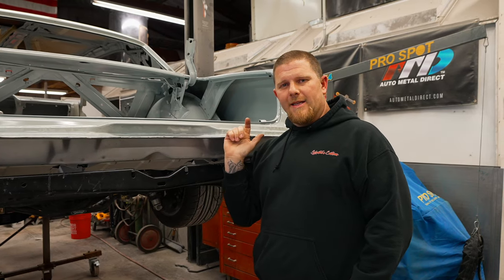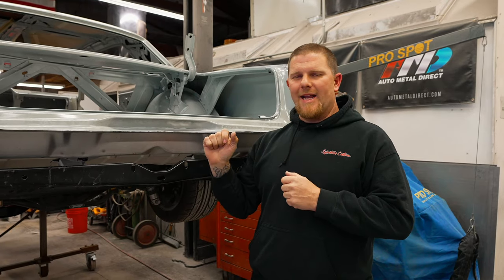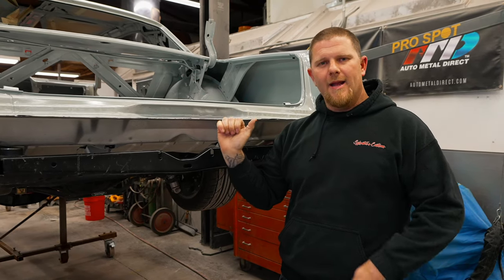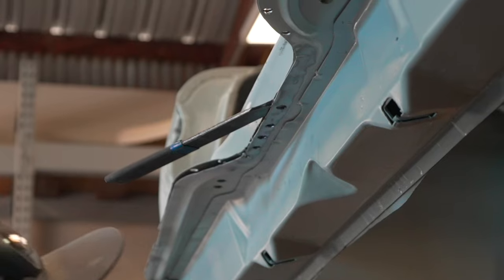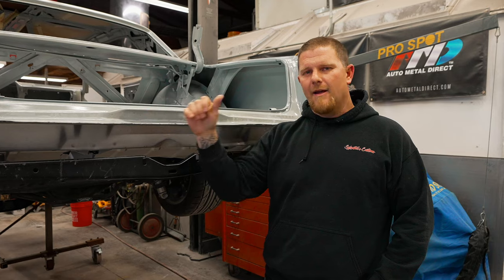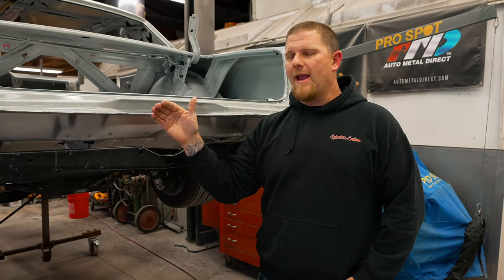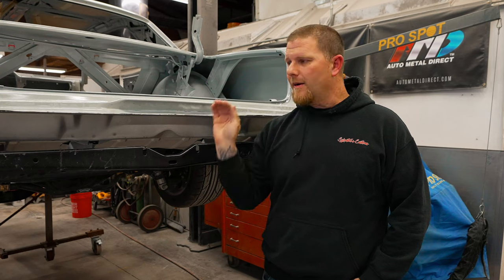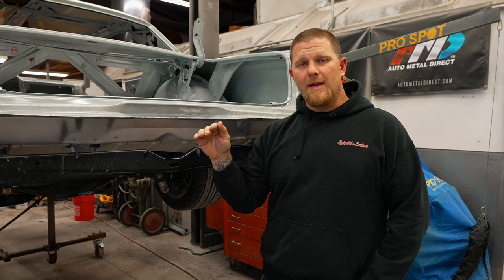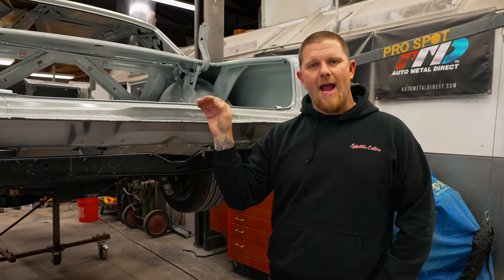Once you get from one side to the other, we use Steck tools. Steck makes a really cool hardened seam buster — S-T-E-C-K — and it has a sharp blade on one side. You can put it in between and leave that tool in place if needed, hammer it in, and work across until you can see the very next plug weld. If the car has factory paint or excessive paint buildup, you'll need to strip the edge around the area to find the plug welds. Just take some sandpaper and rub over it to see the low spots — anywhere a weld seam is, it's typically going to shrink and be lower, so it's easy to spot.